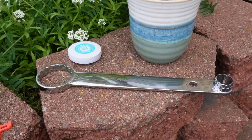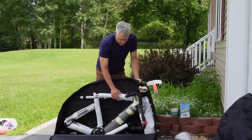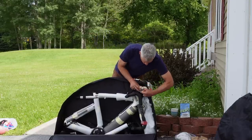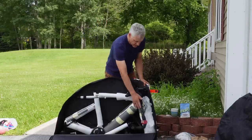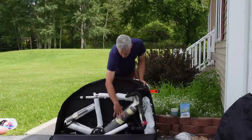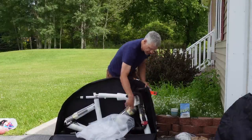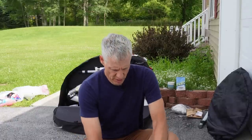Speaking of lessons learned the hard way: bring the rotor tool so you can put the rotors back on. For most cases you have to take off the seatpost and handlebar. Integrated bar-stem combos look nice but can be a real pain when traveling — having just old-school traditional separate handlebars and stem makes it easier to configure. I take the stem faceplate off and pad and secure the handlebar to the fork or the down tube so it's not rattling around, sticking out, or dinging the frame. Non-integrated is easier, and loose cables outside the frame give you a little more wiggle room. I always put my shoes in the bag.